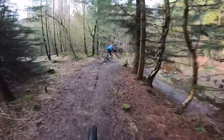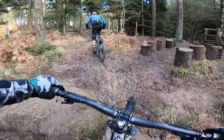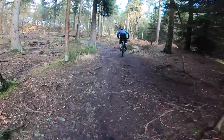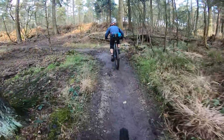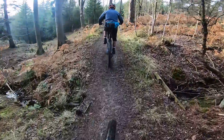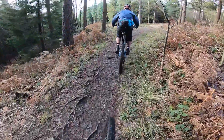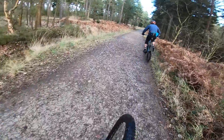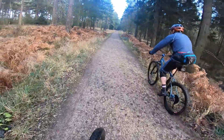The bike feels so composed and sorted even when it's proper greasy, slippery roots. When you want to put the power down you get a super-supple start stroke and then a really supportive, propulsive phase — with enough progression that 135mm always feels like plenty. I started riding this and was blowing through the travel a bit, so I needed volume spacers. Adrian mentioned when we met up that he'd meant to put those back in — I'll let him off that one.